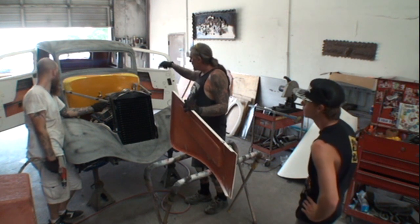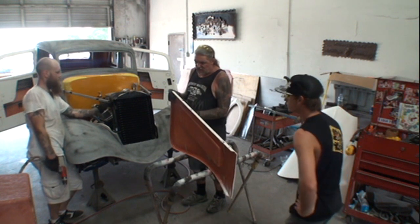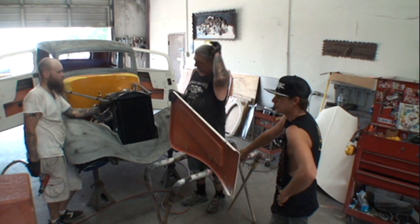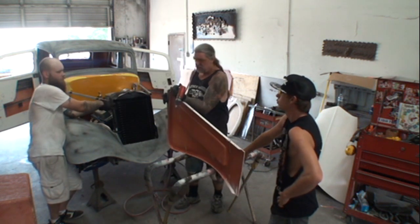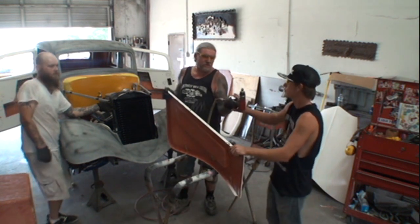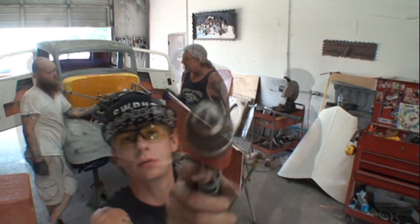We went ahead and drilled our holes, number 9, went ahead and tapped them. I went ahead and drilled out the 1/4 inch for our bolts. Hold that. This is a reamer tool. Go show everybody the reamer tool, please. It's actually a wood reamer. We're using it for fiberglass.